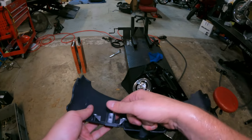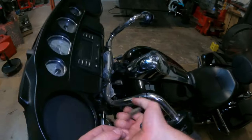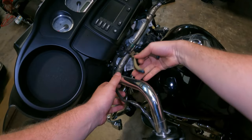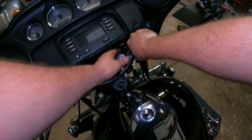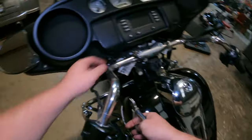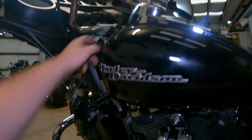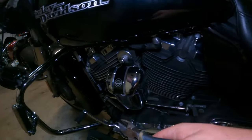The dash bezel — the clip on the right side of the bike has the tab on the back side, so it's a little bit of a pain to get to, and then this one's easy, the tab's on the front. Now I'm going to cut off all these old zip ties — don't cut your wires, it doesn't make for a good time. I'm also going to cut the zip tie in here that holds the clutch line. There should be two of them, it's really hard to see, it's on the bottom of this riser right here.